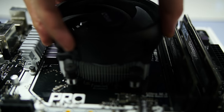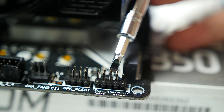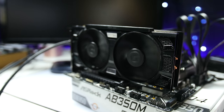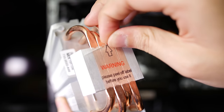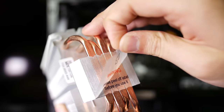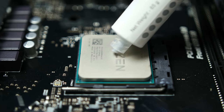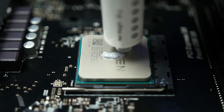You can choose to install the power supply and pre-route the cables, or wait since moving the case around with it may not be easy. Optionally, it's not a terrible idea to install your cooler and graphics card while the motherboard is still outside of the case, connected to a power supply and monitor, then bridge the positive and negative power pins with a screwdriver head to see if all the components work — some motherboards have a power button, but bridging the pins makes you feel way cooler. If you're using an aftermarket cooler, check for and remove any plastic film on the contact plate. If there is no pre-applied thermal paste, you'll need to apply your own. For a chip of this size, use an amount about the size of a pea; for a bigger chip, you can be a little more liberal.